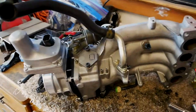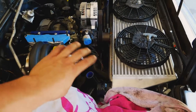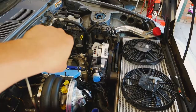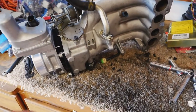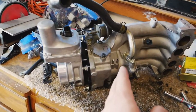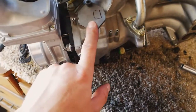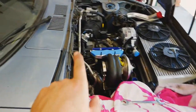Wires facing back like it's supposed to all along. I have my other fast-acting air temp sensor — it's going to be intercooler side, so it's going to be in the charge piping. From the turbo it'll be down into the inlet somewhere around here — that's going to be pre-turbo inlet air. Then I'll have charge air temperature, which is what's going through the intercooler. Between the two, I can figure out compressor efficiency and where it's landing on the map. It's throttle mass flow, so I have MAP sensor before and after, and I also have EMAP in the exhaust — three MAP sensors total. This actuation here is going to need a solenoid — I'll make a solenoid bracket and drop it right here, because this just needs a quick little vacuum line. That reservoir is probably going to sit somewhere on the firewall.